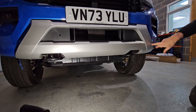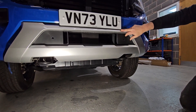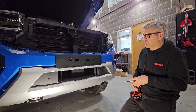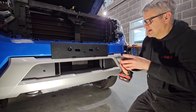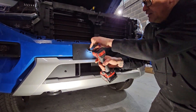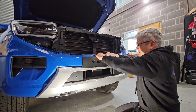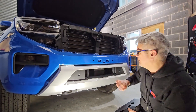You've got the rest of that silver trim off. Behind here there are normally a couple of Torx screws. We're probably going to take the number plate off because it overlaps. So we'll whip the number plate off — that's just held in with a couple of self-tappers. We also need to take this number plate holder off because it overlaps here and we don't want to damage it when we take the silver trim off. It's just an 8mm head on these two — undo those, put them to one side, and it just unclips from there.